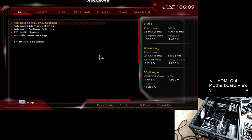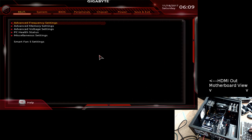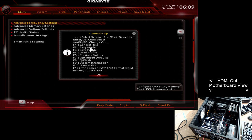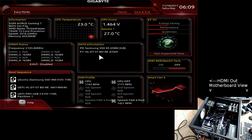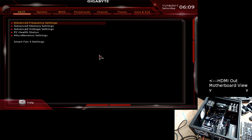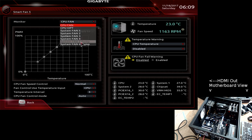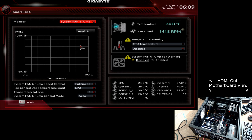And now it's at least 2.12, and it's saying, here, let's go to the simple mode, F2, what is the hotkey for that? Easy mode, F2, and then I'm not sure, is that just a toggle? F2, okay. So it shows here 2, 4, 6, 8, recognizes all 16 here. Probably changed the fan settings, didn't it? CPU pump. No, it kept that. It kept the fan setting, but changed the voltage settings.